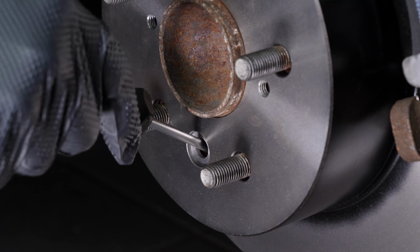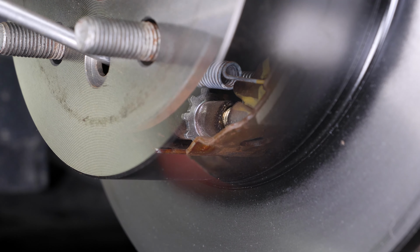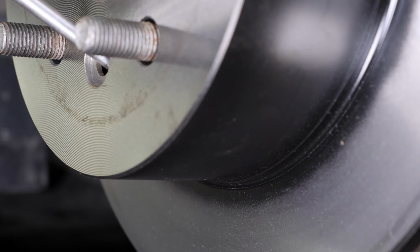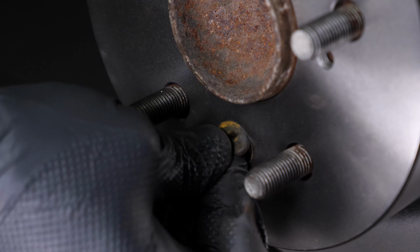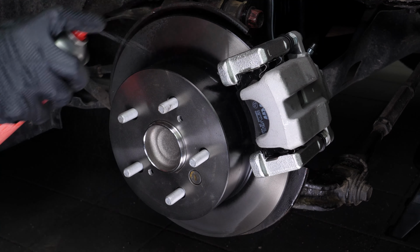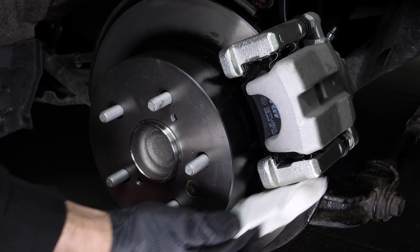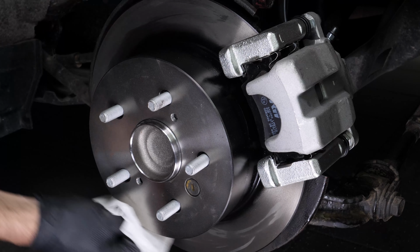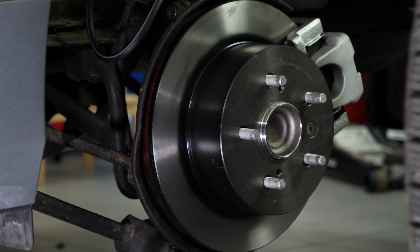In case you adjusted the brake shoes to remove the disc, set the mechanism back until there is a slight friction between the brake shoes and the disc. Put the shutter cover back on. Clean both sides of the disc with brake cleaner and a cloth to remove grease deposited while assembling the parts. Then you will be able to put the wheels back on your vehicle.